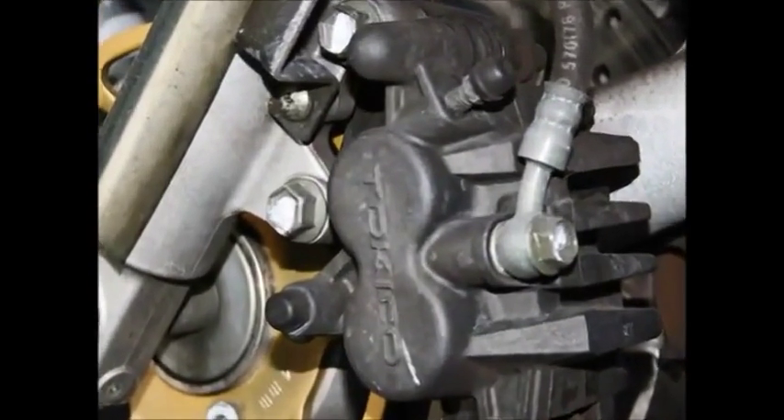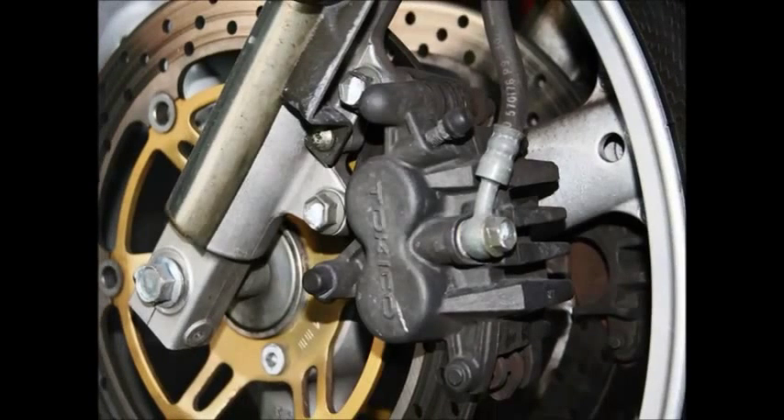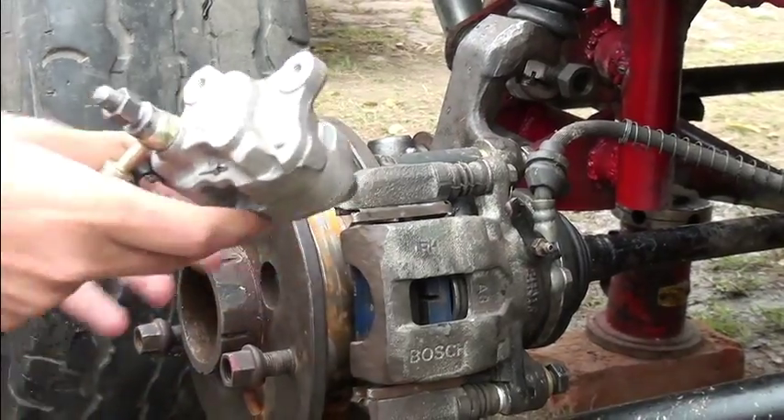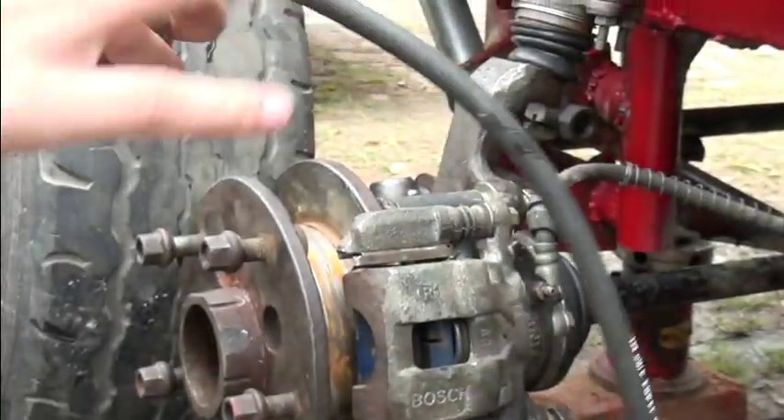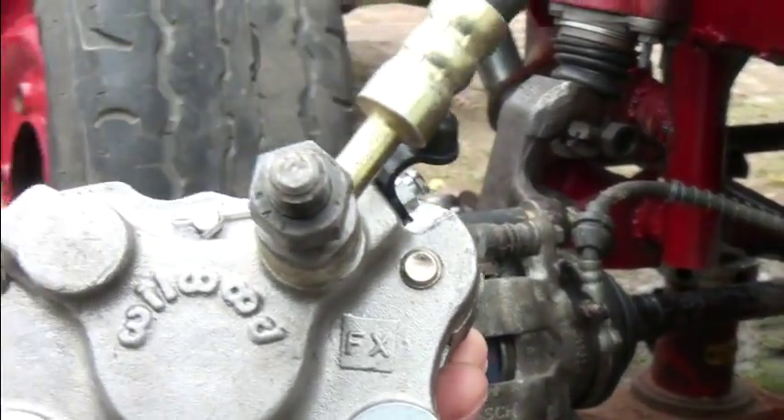Such brake discs cannot be accommodated in small competition car rims, so people use them with smaller discs. This can be dangerous because they do not get a good contact area on smaller sized discs and may not be able to provide effective braking. Wilwood calipers are specially designed for race car applications and, being small in size, give a compact look to your wheel components and enhance workability.